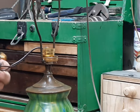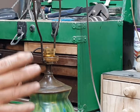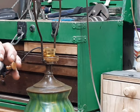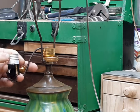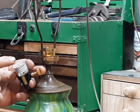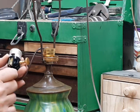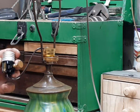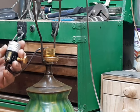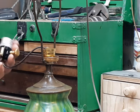The purpose of the different wires and different colored screws is pretty simple. The brass screw is what they call the hot wire — just a name, both of them are as live as the other — but it goes through the switch and then goes to the terminal in the middle, which the base of the light bulb touches. The silver screw goes to the shell. What this means is that if you walk into a dark room and reach up to turn the switch but touch the socket by mistake, nothing happens, because the power has to come through the smooth wire through the switch first. If you were to wire this backwards, anytime somebody touched the shell, regardless of whether the switch was on or off, they'd get shocked. So you can't have that.